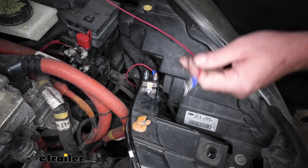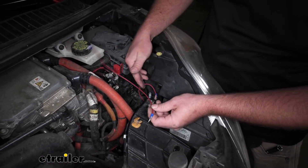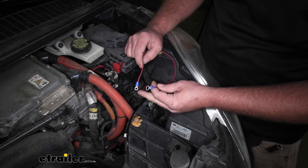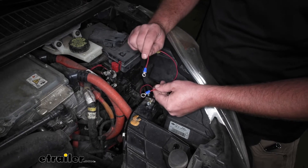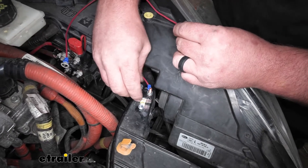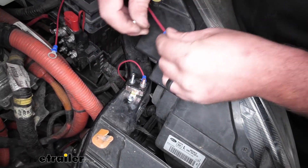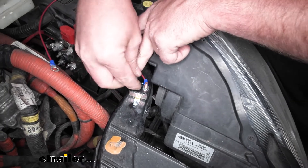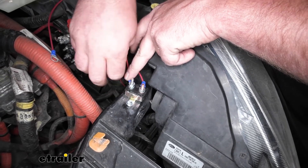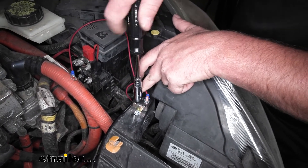For this one it's really simple. Take that leftover piece of wire that we trimmed to length — strip back the ends of the insulation. One end is going to have a small ring terminal, the other is going to have the bigger ring terminal. That small ring terminal we're going to put on the silver post, run it down, and tighten it up.